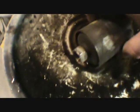Well, here's where we're at. I got the distributor changed, got it to start, and I can see why it was so hard to start. I should have done this over something clean, but there's what came out of there. That's what came out of the filter along with some chunks. Tried blowing through it. Filter is plugged. No air going through. Now my batteries run down again.